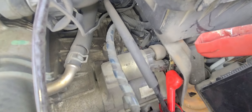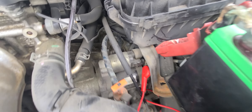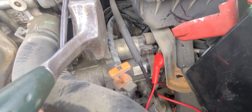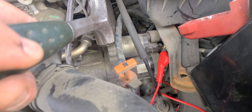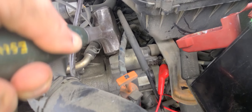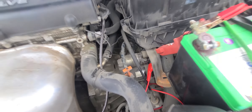Unfortunately it's just not activating the starter. I'm not exactly sure what's going on, but we're gonna go through it real quick. The thing I like to do when I get a no start and I've got signal there is I like to tap on the starter with a hammer — right here where the solenoid is, just give it a little tap.